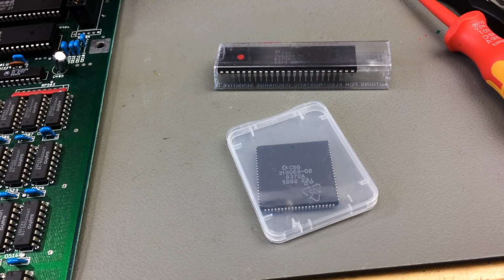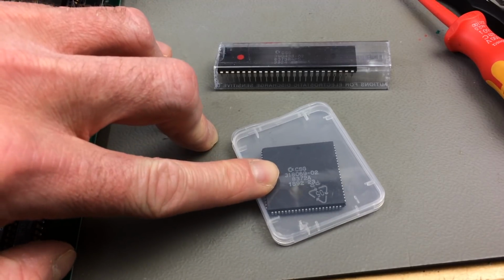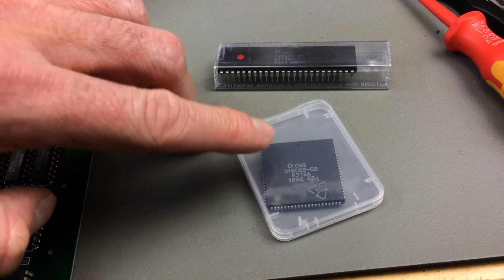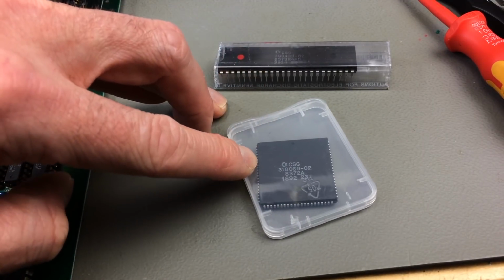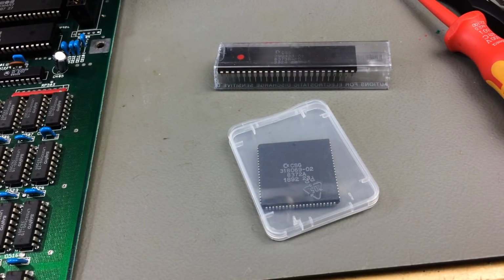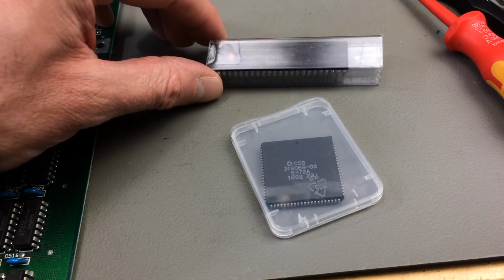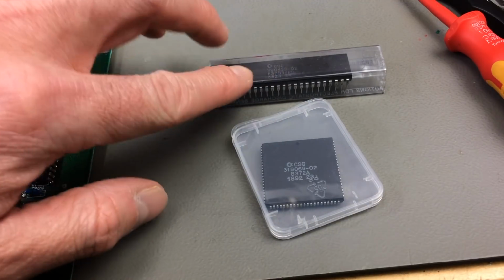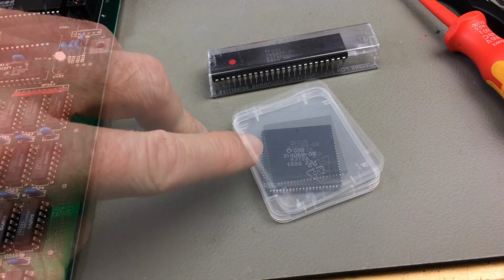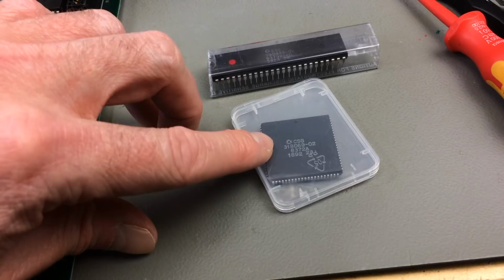In order to convert our memory to all chip memory, we need one of the newer fatter Agnuses, which is the 8372A, which supports both NTSC and PAL, so it's the same chip for both regions. And to bring the Amiga up to full ECS, we also need the Super Denise, which supports the graphics modes of the ECS chipset. The more important upgrade of the two is the 8372A upgrade.